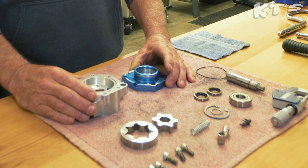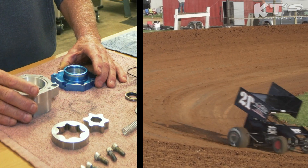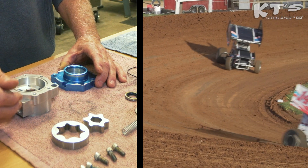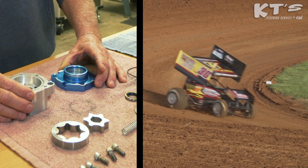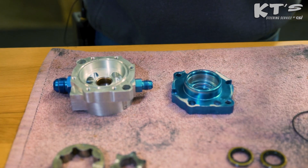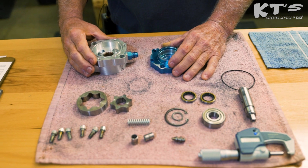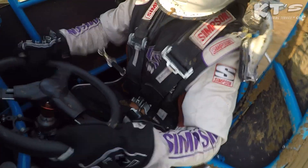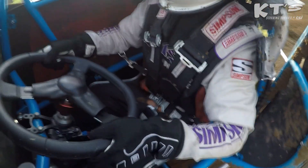The other thing that happens is as you get into a load situation — like if you're driving down into the corner with your wing car and winging down real hard on the left side and the loads come way up on your front tires — if your pump can't react to the higher load levels, all of a sudden your steering is going to get stiff. I've actually had some drivers describe it like the steering's locking up going into the corners, but that's actually not the case. What's actually happening is it's just becoming more and more of a manual situation instead of a power assist situation.